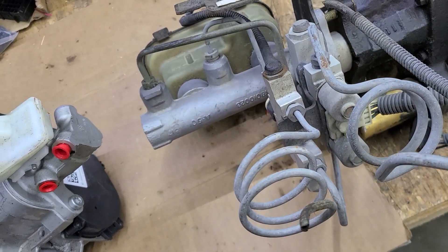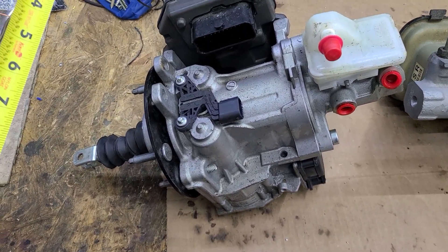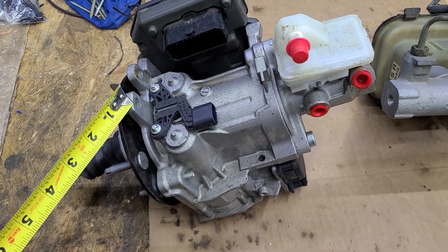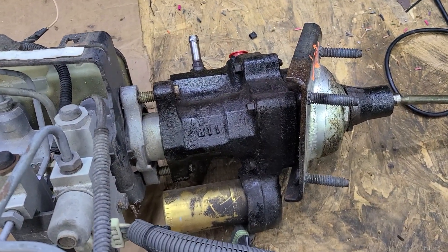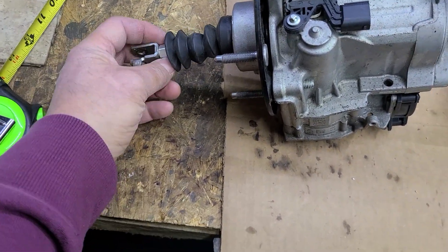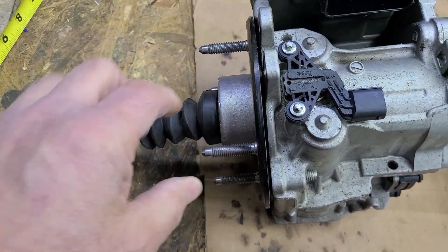So the alternative to this is when they came out with all the hybrid vehicles and then the all-electric vehicles, they came out with what's called an iBooster. Comes on a lot of different vehicles — primarily this is an early series Tesla version. The Honda CR-Vs come with this. This item is actually off of a 2019 Honda CR-V. It works similar to the Hydro Boost with the rod pushing on a small rod which basically opens up hydraulic pressure to increase the boost, but this does it electrically. This connects up to your brake pedal, which is kind of nice because this is a threaded shaft that comes out, so you can unscrew it and adapt it over to whatever type of firewall. This is, I think, 65 millimeters square, and it's a flat plate.